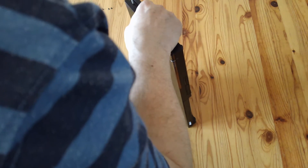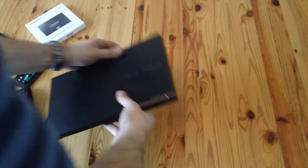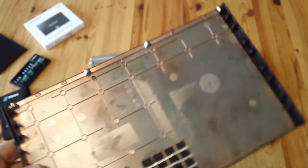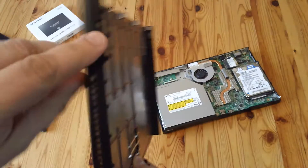There might be a bit of swearing because it's quite difficult to get off, and there's actually another screw on the side which needs to come out too - also a 2mm hex. So that screw was in there. Let's just tease the lid off. You'll probably find it a bit more difficult because there are various clips - one there, one there, one there - that one has actually snapped off, but you do need to undo that screw on the edge.